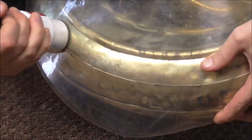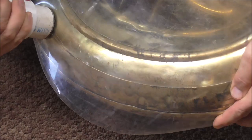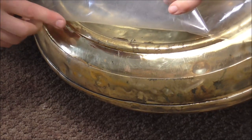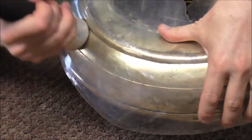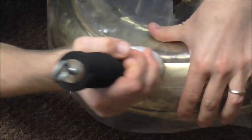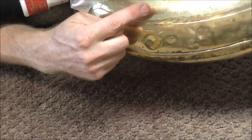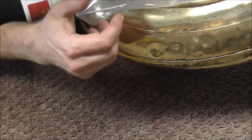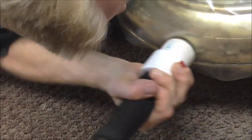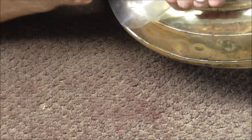Now I'm going to go over this. You have to go back and forth usually several times. That looks a lot better than it did — not perfect yet, but I'm going to go over that again. I did notice there's a dent right there. The dents underneath the bow guard are harder to get out because the metal is two pieces of metal thick instead of just one piece. I'm going to see how this works. If it does not get those dents out, I'm going to switch over to the larger magnet. I'm going to run this back and forth several times over those dents. Those dents are a little bit better, but not too much. I think I'm going to have to switch over to the larger magnet.